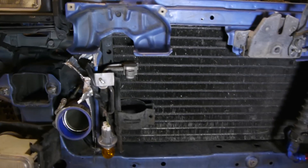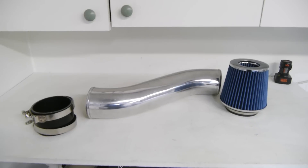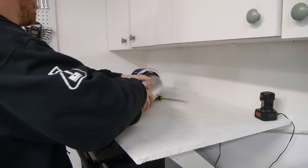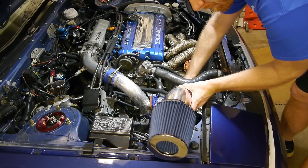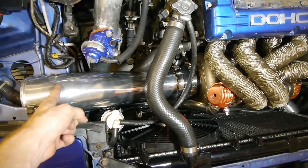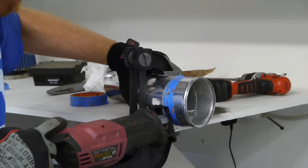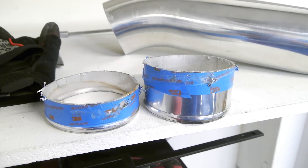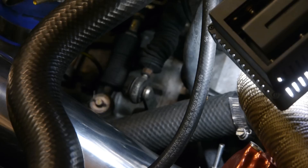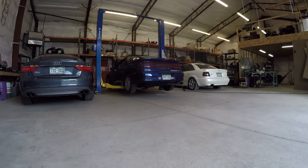I'm going to cover the cooling and AC setup in a future video, so keep an eye out for that. But for now it's working great. All that's left is to install the intake — this was pretty easy; the hardest part was waiting for it to arrive in the mail. After a quick test fit it was a little too big, so I grabbed the sawzall and chopped it down — took a little off at first, then a bigger chunk, then a couple smaller chunks until it was perfect. It pushes the lower radiator hose back a little bit, so I double checked it wasn't going to interfere with the shift linkage, and it all works fine.